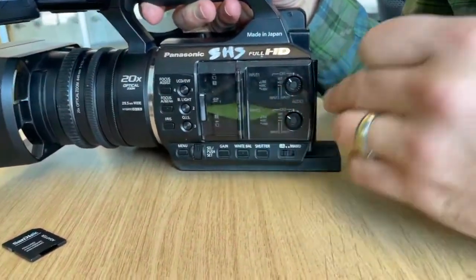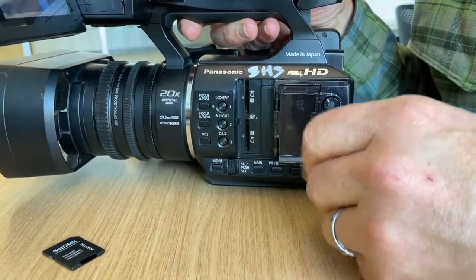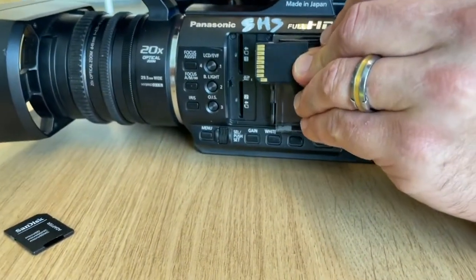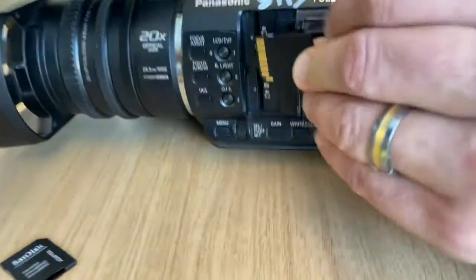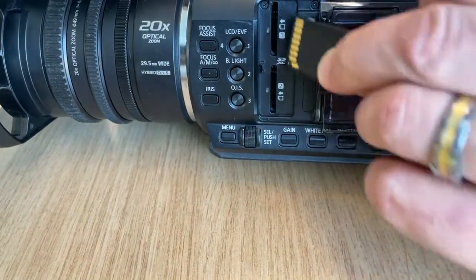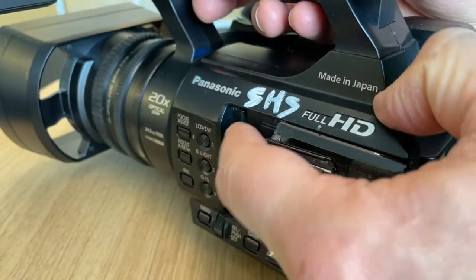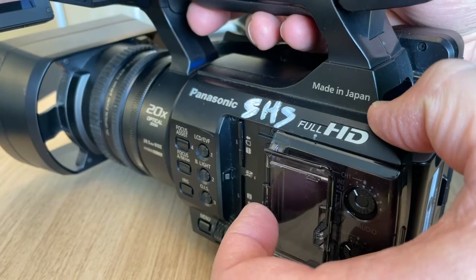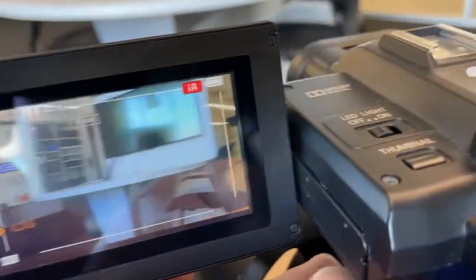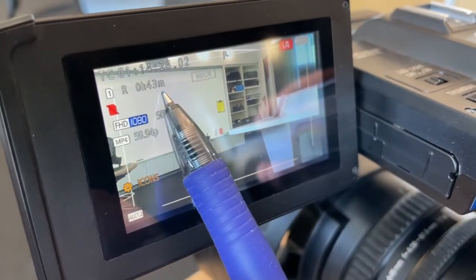There are two doors here. The back door is for our audio; the front door is just for our media. Now, it is indexed — it shows you that the teeth of the card, or the contact points, should be facing you when they go in. The clipped corner is down there and it matches up with card slot number one. Push it in until it detent locks — they're spring-loaded. Once locked in, it will show up on the viewfinder. It will take a little bit of time to read. I've got 43 minutes of record time on this card.